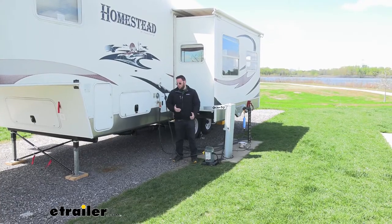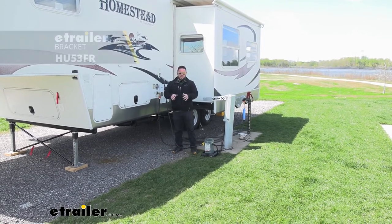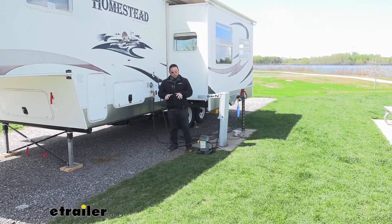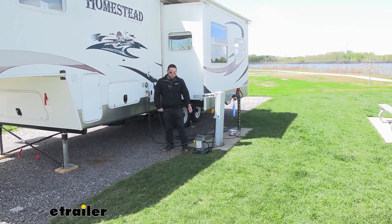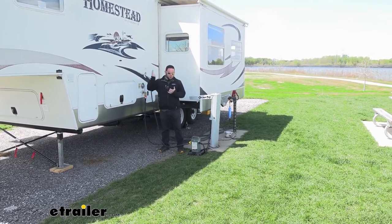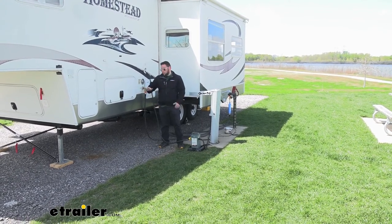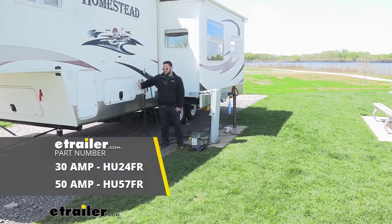There's another option if you want a place for it to stay while you're driving and not using it — you can put it inside. There's a bracket you can buy that mounts on the floor with straps that come over and lock it in place, so it stays put when you're driving around. Overall, I think this is a great addition to your rig. It's going to protect against voltage dips, voltage spikes, and surges — so you know you're not going to damage anything in the rig. That's way better to replace something like this than something inside your rig.